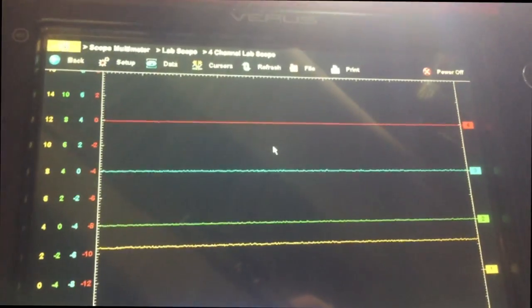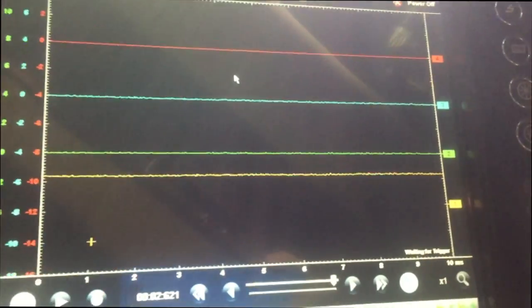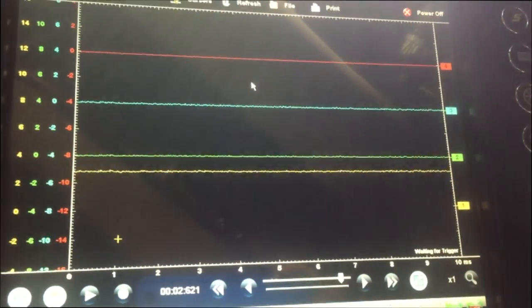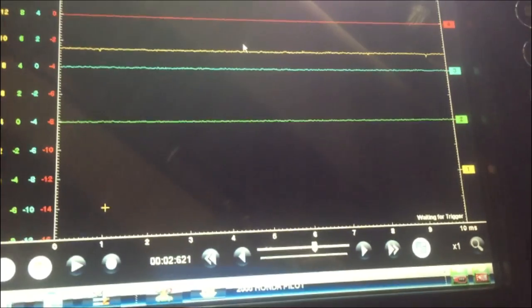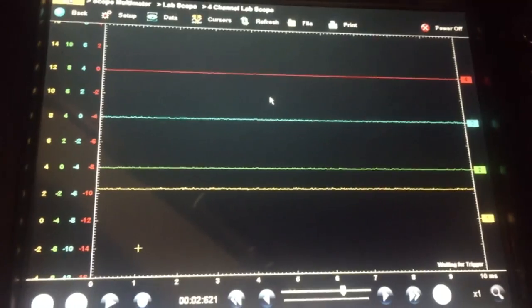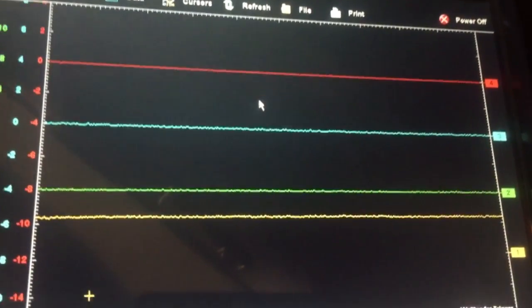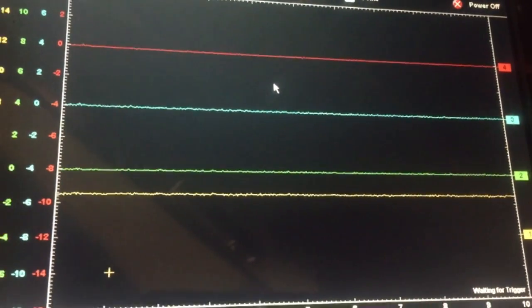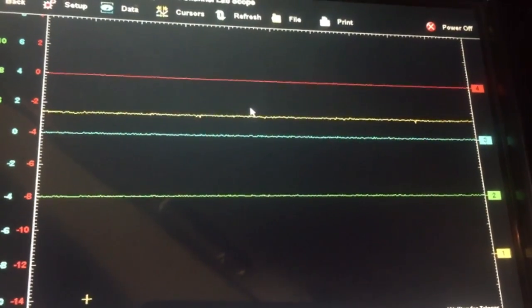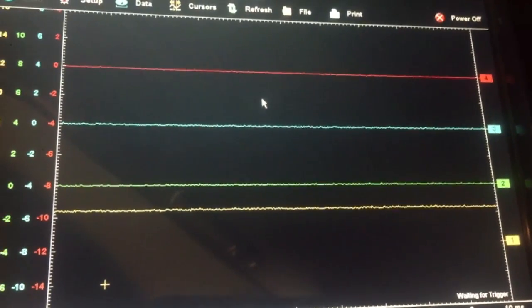I can see here with my scope, and I'm on the yellow trace here, if I increase the blower motor speed, it basically changes the voltage. So anyway, the moral of the story is at least verify that your voltages are changing to the power transistor with operation of the HVAC control, so that you know it's being controlled.